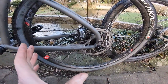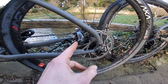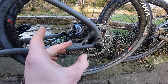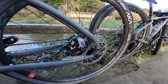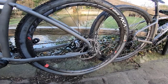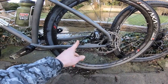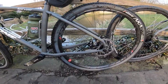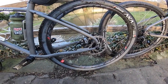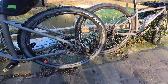While the bikes normally come with an Avid BB5 cable brake, this one is actually running the brand-new Reva MTX1 calipers, which are a really nice double-sided cable disc brake — rather like the TRP Spyre. I've been really impressed. It could do with compressionless outer — I just stuck some standard brake outer on there and on a super long run it could really benefit from proper compressionless outer — but apart from that, surprisingly good and surprisingly controlled.